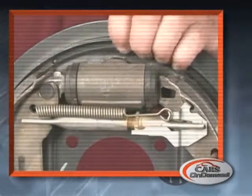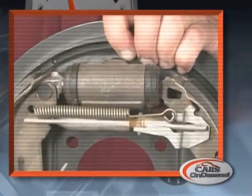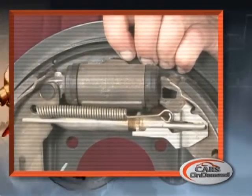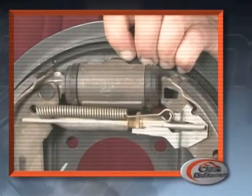Knowing how the self-adjuster brake system works and what style it is, is important to know when working on your next vehicle. The self-adjuster operation of a disc brake assembly is done automatically with a caliper. When we take a look at drum brake assemblies, the self-adjuster is something we can actually physically see operate if we are to operate with the drum off.